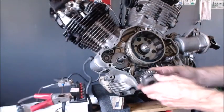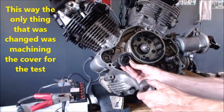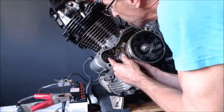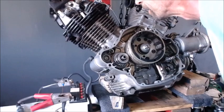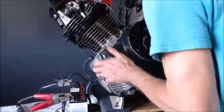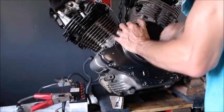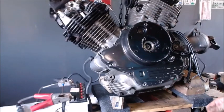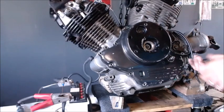And we can reassemble with the big spring, regular spring, and no clip, because I want to see what it'll do for just having that machining surface machined down. Looks like we're lined up pretty good. So now let's see if we can get a cover on. All right, so we're fitting pretty solid there. I think we got enough room. So let's tighten all these bolts up and then spin it around and look inside of there and just see how much engagement we got now.